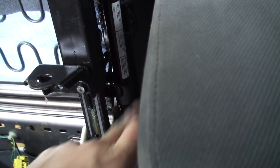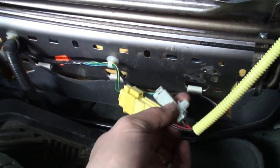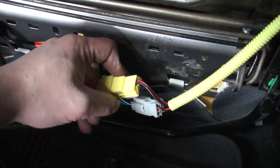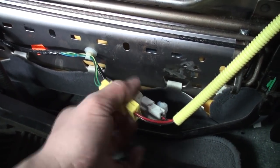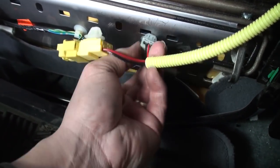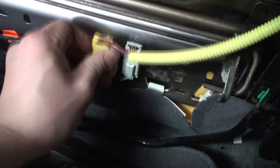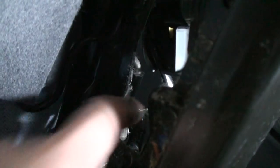The lower cylinder portion of the seat belt buckle also needs to fit into the bracket area between the two tangs. Next, reconnect the SRS connector assembly and the driver's seat belt warning light connector. Make sure the protection sleeve has slid from the unlock position back to the lock position — the sleeve should be close to the white nub. Then carefully snap this back into the seat rail, and double-check the routing of your wiring to ensure all clips are properly seated and the cable wraps around behind and into the spring.